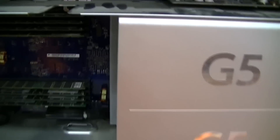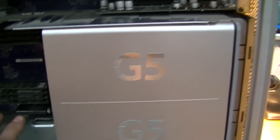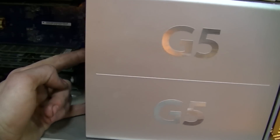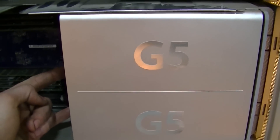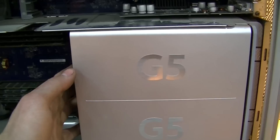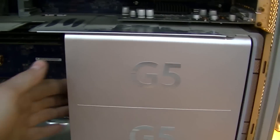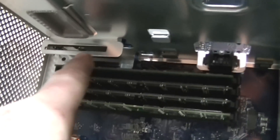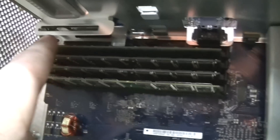That's pretty much an overview of the inside of this thing. There are two front-side buses, one for each CPU, and they operate at exactly one-half the clock speed. So this is a pair of two-gigahertz processors — we have a pair of one-gigahertz front-side buses. There is a wireless card slot here which I'm missing, and I don't know where the Bluetooth hides but I think that's missing too. I don't really need wireless in a server, so I don't care that much.